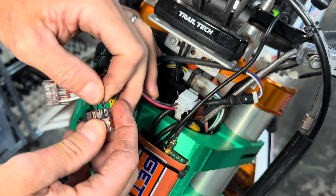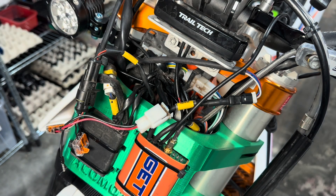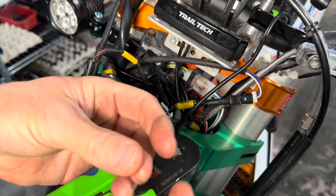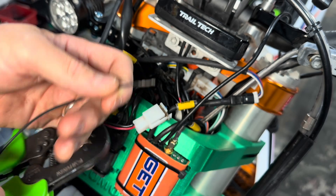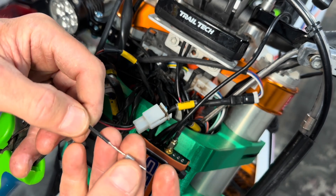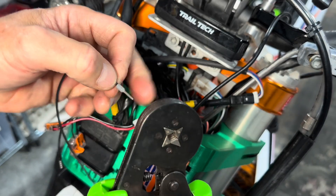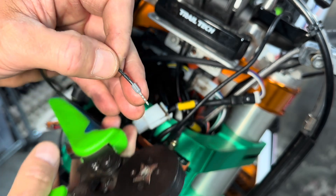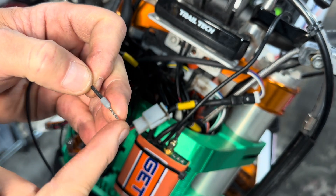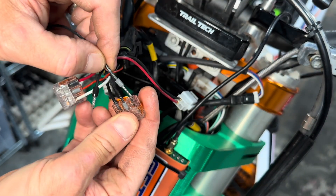The other thing he noticed is that we have this little wire management device. When you have a stranded wire, you end up with sometimes a little bit of a mess where you have your individual conductors and they'll fray — they'll get all boogered out. What you can do is slip this little sleeve over the end of that. There's a special tool that comes in a little kit that you can get, and you insert that, crimp it, and now you have all of your wires managed and controlled inside of this little pinch sleeve. Then that can go into your port.